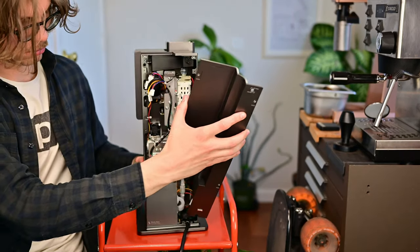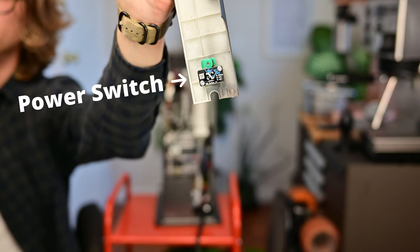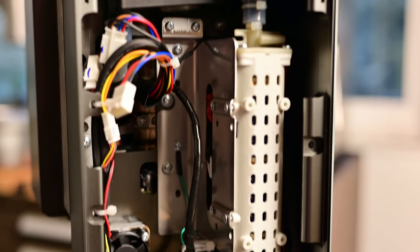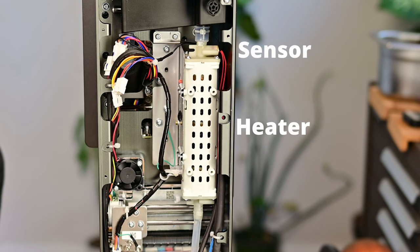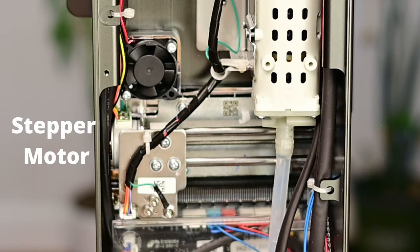I moved it around a bit and disconnected the last cable, which, along with the water level sensor above it, was holding that plastic panel to the rear. There was then a really nice view of the internals. Here we can see the water heater on the right, which appears to just have one temperature sensor on the outlet. Then there's a small PC fan that blows the steam away from the water outlet circuitry. Directly below it, there's a small stepper motor that drives the pod left and right, and you can even make out two stops that let the motor know when it hits its left and right limit.